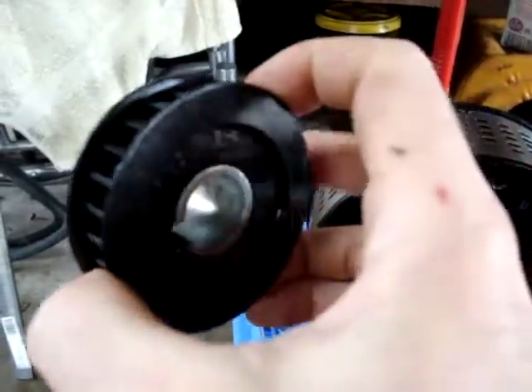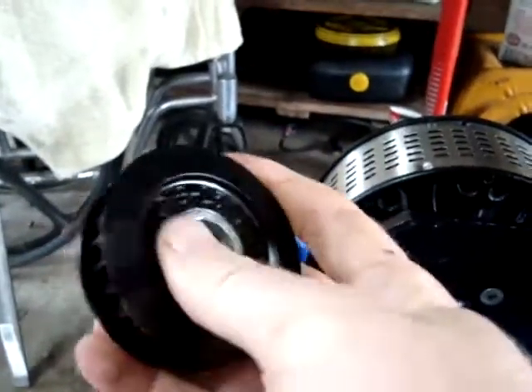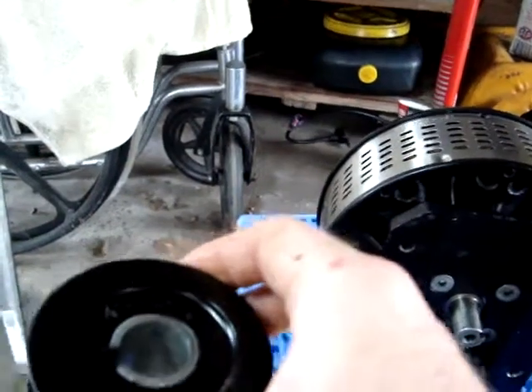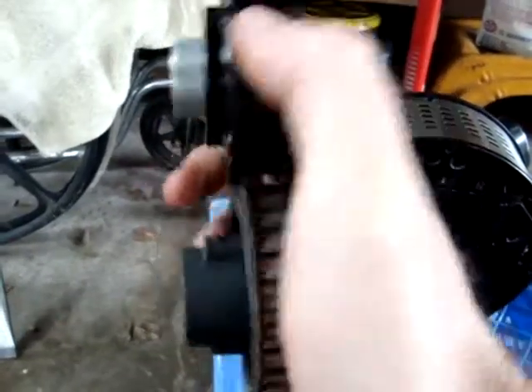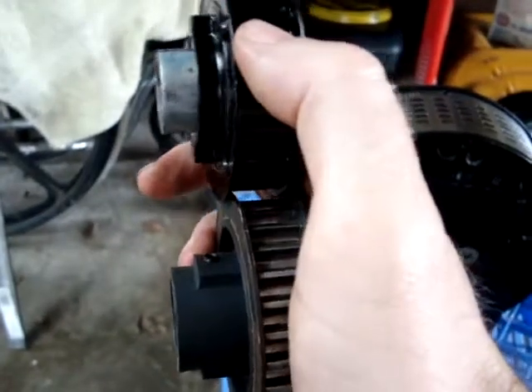This pulley — the way I found it — I tried emailing Zero to ask them where I can get another pulley; that was about three weeks ago and they still haven't responded. So to get this one, I called up a motorcycle shop in Austin, Texas, asked for their parts department, and after about a week he called me back and was able to locate a pulley made for this belt. Both pulleys are an eight-millimeter pitch — that's the distance from one rib to the next — and both have a width of 15 millimeters, so they can accommodate a 14-millimeter wide belt, which is what I've got.